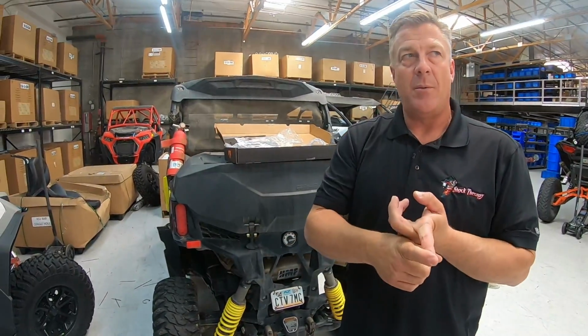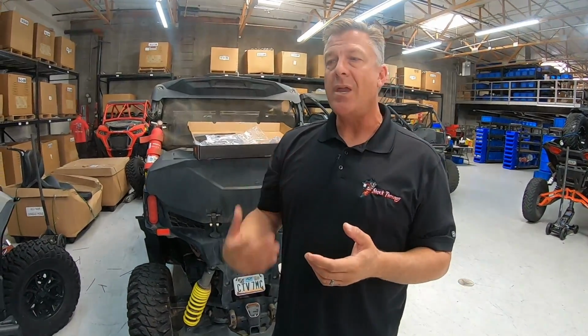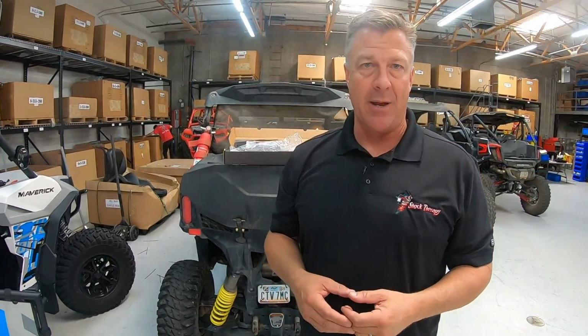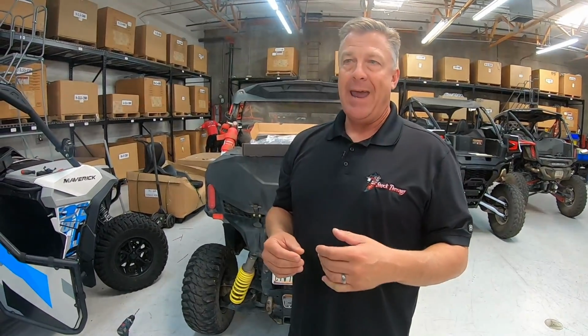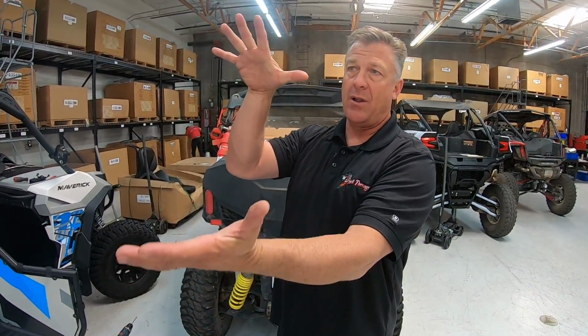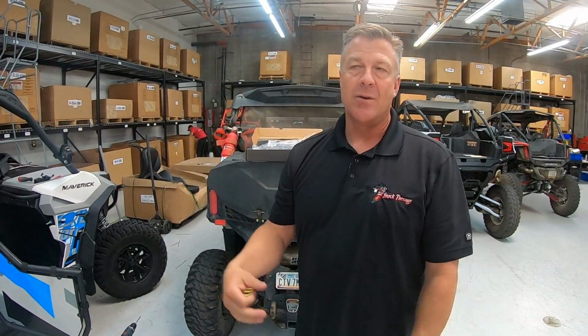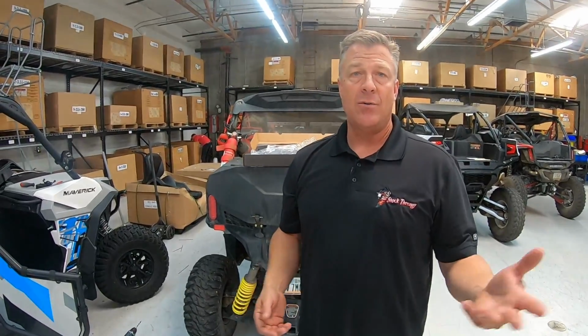In the desert, we probably like to see you run between 12 and 16 PSI. In racing, you're going to see it all over the board, but somewhere between 20 and 28 pounds. The reason we run so much in racing is because with 18 PSI in a tire, when you go through 3-foot whoops at 80 miles an hour, you can hit that whoop so hard it'll collapse the sidewall and pinch the sidewall on the wheel, and you'll get flats. So more air pressure saves the wheel and gets fewer flats. For play though, 12 to 16 pounds.